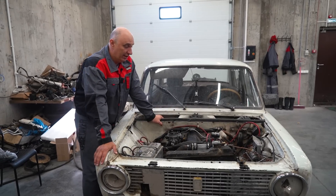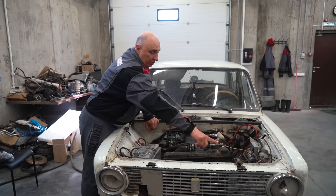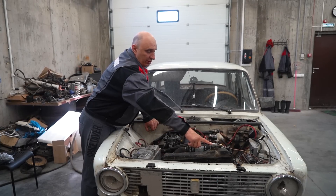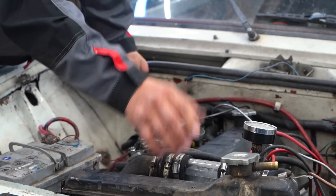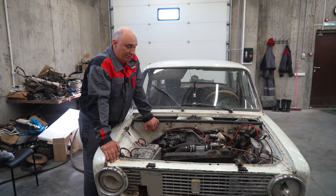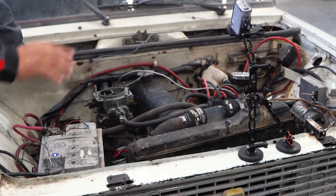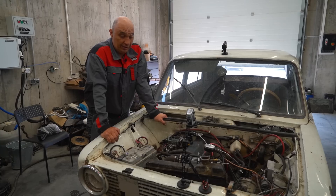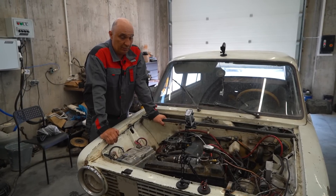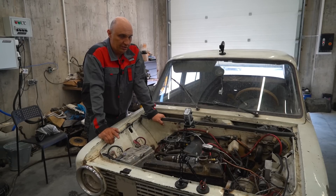It's used to measure temperature and pressure. So I think we're running more than enough temperature gauges. The reason we'll need a pressure gauge is that the cap usually indicates the pressure at which the valve opens up and relieves any excess into the overflow tank. The interesting thing would be to see what the engine temperature is at that point. So let's start the engine without the cap for now. A contaminated system means less heat transfer and less time for the engine to get hot.